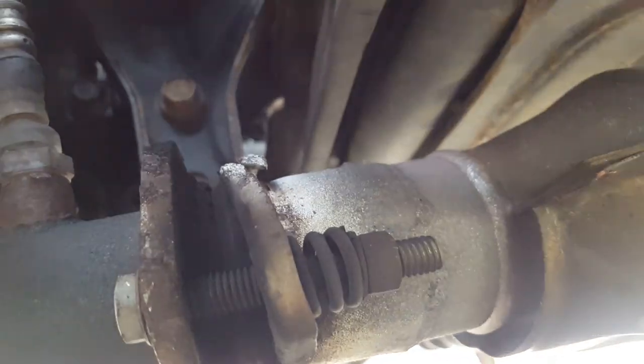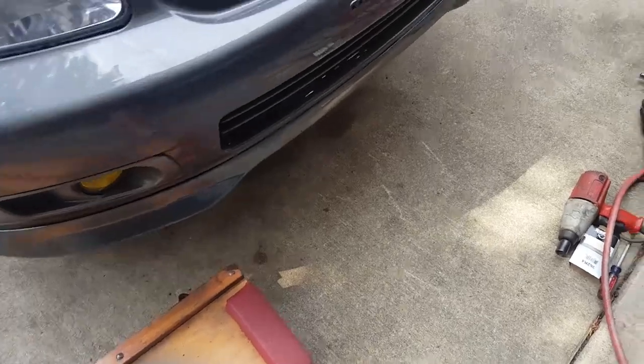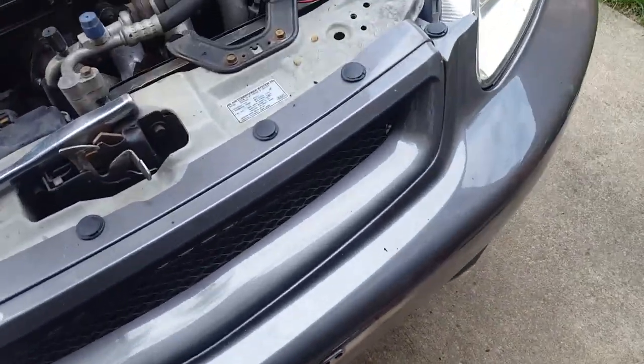So this is what I'm going to have to replace right here. I actually bought a replacement. Right here you can see my catalytic converter — the heat shield on it rusted apart. You can see it if I push on it. I'm just going to put a screw on the back and one on the other side and screw the heat shield together on these little pinch welds. That should fix it. I put zip screws in that exhaust so that it stops rattling.